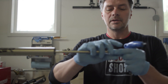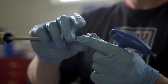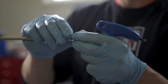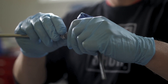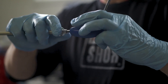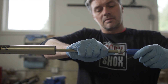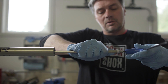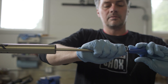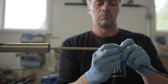Now we're going to install our casting plug on the rebound shaft. Install it just like that, then put your foot bolt on and we're going to tension that up to ensure it seats on the rebound shaft. This is a very important step to ensure your Charger damper fits well in your lower leg. Then once it's tensioned, back it off and remove the foot bolt.